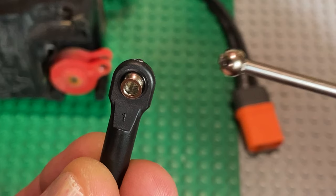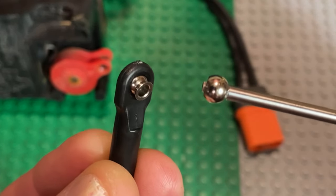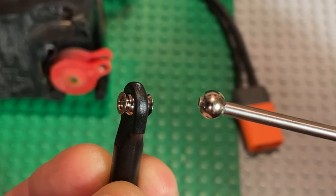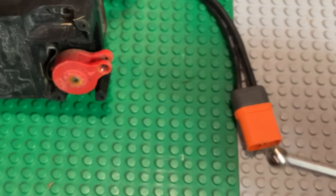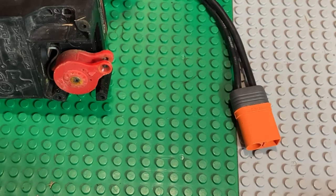These parts here are basically what's left over from that video. In my left hand are the metal pivot balls — you can see they have a flange or a little lip on each side. What I've done is ground them down, and the 'after' version is what's in my right hand. I use a Dremel tool to do that.